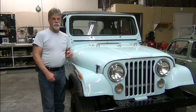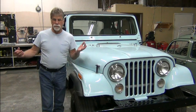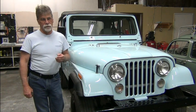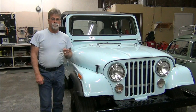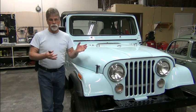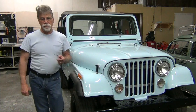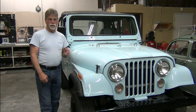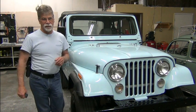The first ones we did were the back. They were the easiest to get to, and we noticed there were some bad cells. So that wasn't good news. Their voltages were all over, so we realized we're going to have to replace those cells and bottom balance the pack. That was pretty much the minimum, and the containment.